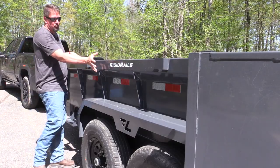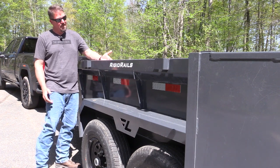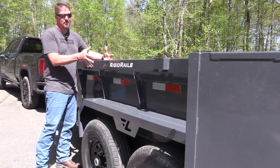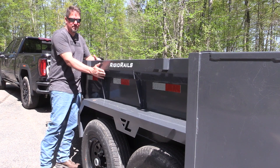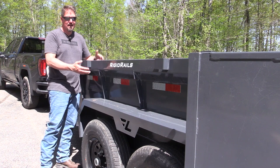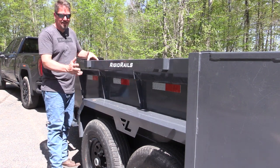The next thing you'll hear about is rigid rails. These rails are welded on the top, then bent over and down and welded along the bottom, so you've boxed this in. A lot of other trailers will actually have C-channel that is bent up and over and connected to the side piece. What's stronger? Probably the box steel in this case.